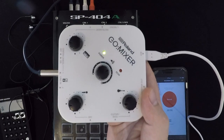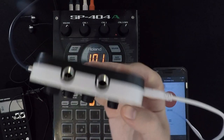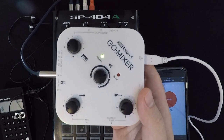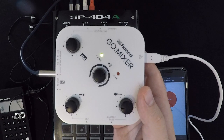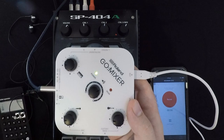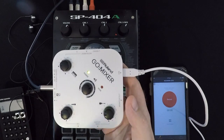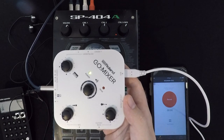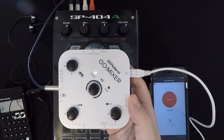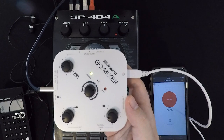First I should talk a little bit about how I feel about the GO:MIXER. Pros: it's lightweight, it's slim, and it's got a hell of a lot of inputs. So I can have the SP running into it, I can have a guitar running into it, I can have a mic running into it all at the same time. The con — the major thing that's annoying me — is that the master volume controls the overall recording level into the phone as well as the monitor out, which is your headphone listening level. The trouble with this is that to get enough level from the line in to get your optimal volume in the videos you're recording, it's not only too loud to listen to, but also often starts distorting.